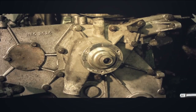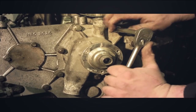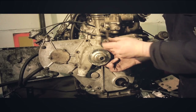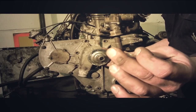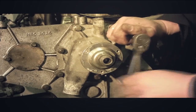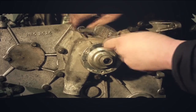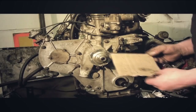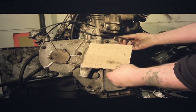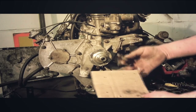There's also a 13mm you'll need for the top one here. Now this is actually a nut — if we have a look, it's a stud. This can cause complications if you're taking the cover plate off, so just keep that in mind. That one has a 13mm head as well but they're M8s. To keep the bolts in order — and this is very, very important — I've made a card up.